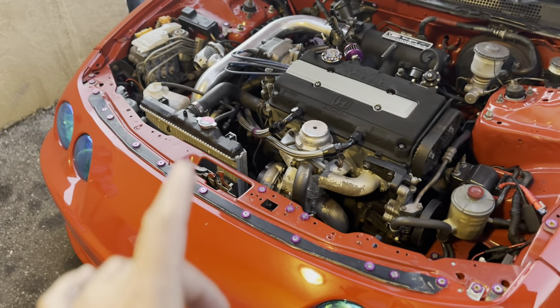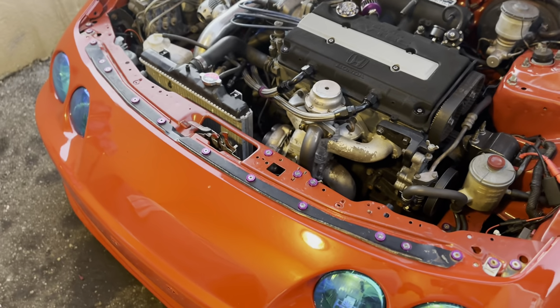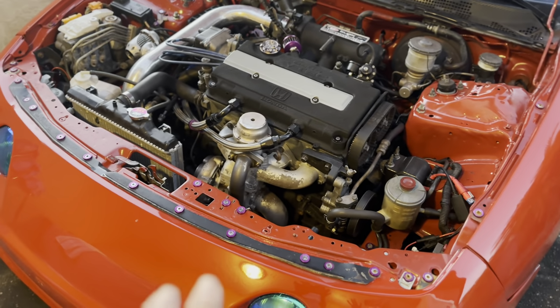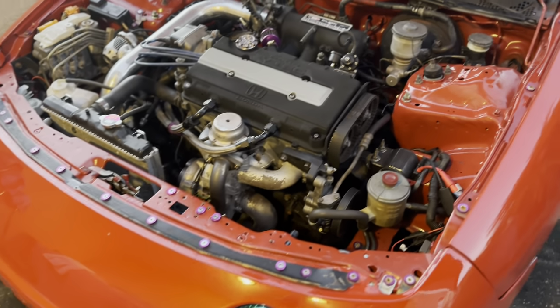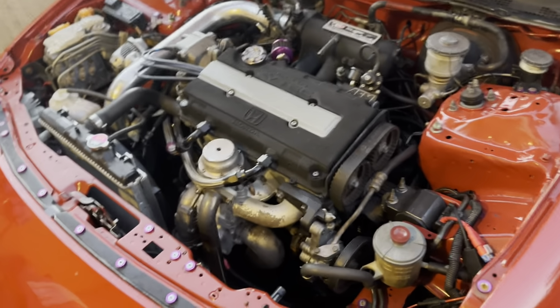I don't know if that was exactly what had to do with my issue, because I did notice that in the radiator with the VTEC pump, I barely had any flow at all. With the LS non-VTEC pump, I have a ton of flow even on idle. So it did help, but that wasn't what solved everything.